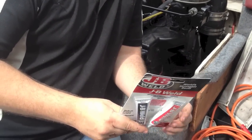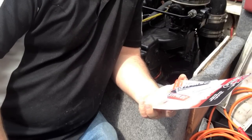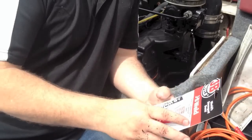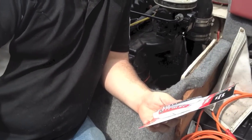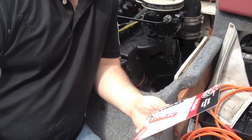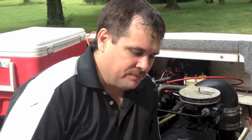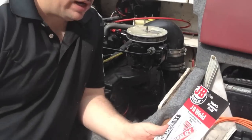What you're going to need — this is regular JB Weld. I went to the website just to see if it might work for this. It says it can work on cast iron steel, and you want to get just the original JB Weld because it holds better. It's heat resistant, I think up to 600 degrees, and it takes a little longer to dry — 15 to 24 hours. And that's generally with any adhesive, the slower it dries, the stronger it's going to be.